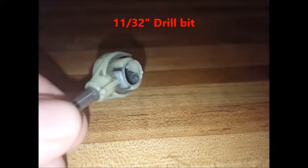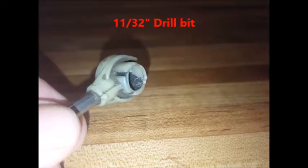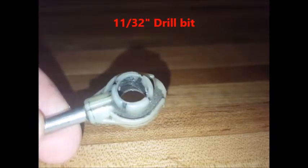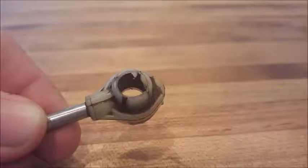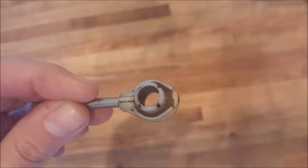If you're successful at that, then use the black bushing — the smaller bushing. Once you've drilled it out, it will look like this. After you install the black bushing, you can reconnect the cable to the transmission and test the installation.